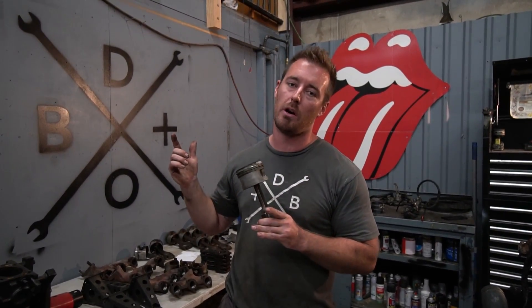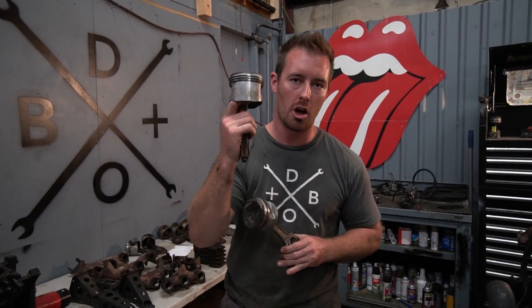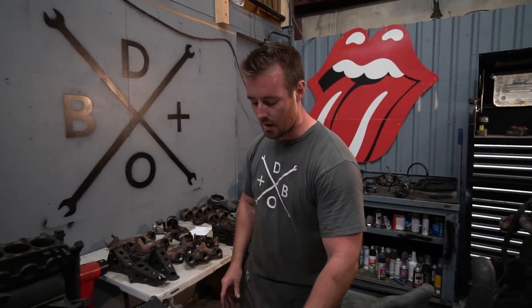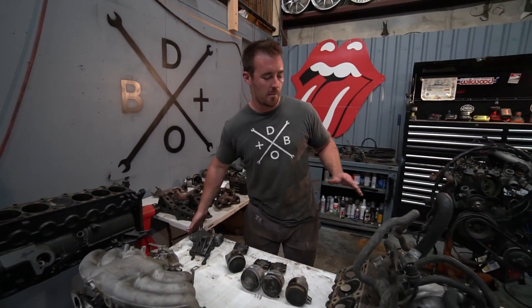This is the one that works with the B27 crank. I will give you a part number — it will be in the description. I'll also list part numbers for the B27 piston as well as the longer skirt early 325i piston, so you can find your part numbers, do your checks, and make sure this is going to work.